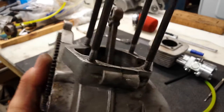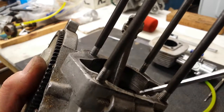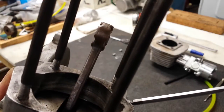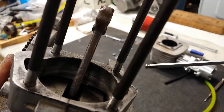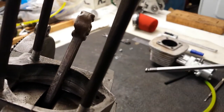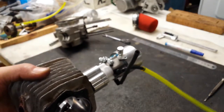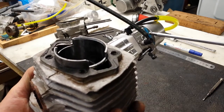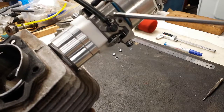When the piston is descending, it's building pressure in the crankcase. As pressure builds, it tries to force air out of the crankcase. In this case, the only way a pressure pulse can escape is through that hole. There is a shuttling of pressure happening in the pulse line, coming from the crankcase, going down this line and into the diaphragm of the diaphragm carburetor. That pulse moves the diaphragm backwards and forwards and allows fuel to move through the carburetor.